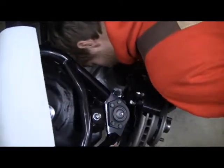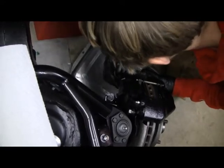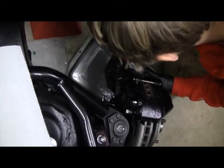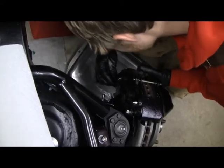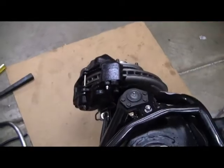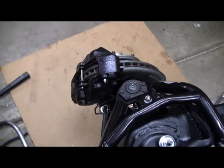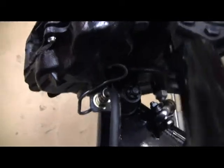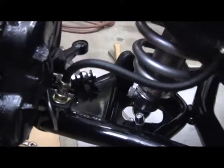So those calipers — they're tough to put on; it's definitely a two-man job. Again, these are the old four-piston, two-inboard, two-outboard. I believe they were made by Kelsey Hayes. In 1969 they went to the single-piston ones, which are much simpler. So the calipers are on. We just spent at least an hour getting these little brake lines on — those little S-shaped brake lines and those hoses on. They are quite the bear to get on. I can see why GM changed this whole mess after a couple of years. But they're on.